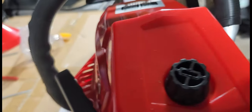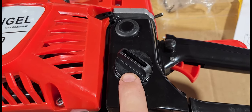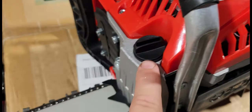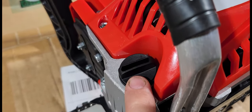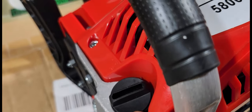This is going to be my choke, this is going to be my power on. Once I get some fuel in it, I'm going to pull it right here and we should be good to go. We will be adding our gas and oil mixture here — we're going to do a 20 to 1 mix. Right here is where we put our chain oil, and I've got some bar and chain oil to use. You can also use a 10W30.